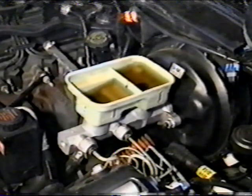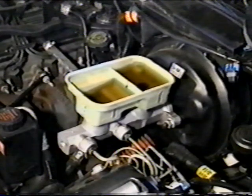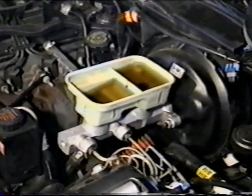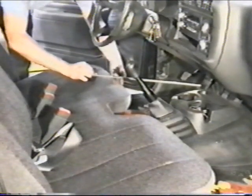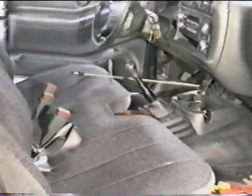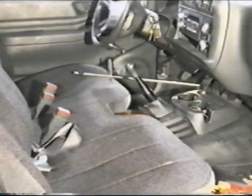The design of the master cylinder on these vehicles allows for the system to be pressure bled very easily using the Phoenix injector. The first step in bleeding these vehicles after the reservoir is drained is to install a brake pedal depressor so that the brake pedal is depressed approximately 1 inch. This step is one of the results of the research that Phoenix Systems has had done.